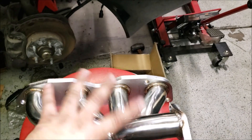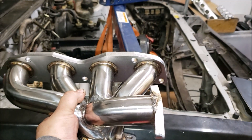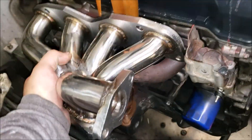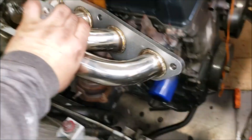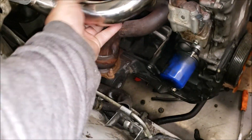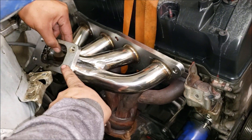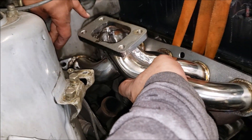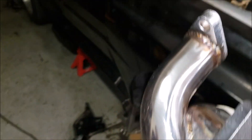What we're going to do — same as with our intake manifold — is cut here, here, here, and here, and flip it in reverse. If we put it on as-is, the turbo would be hanging way too low with no clearance. Flipping it makes it a top mount. We'll level out the turbo flange and the wastegate will point toward the back, where we'll run a V-band external wastegate.